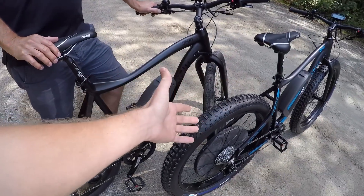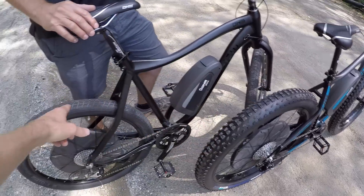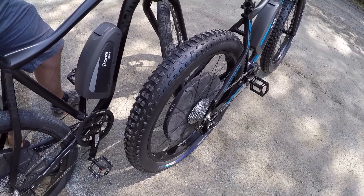That higher thread count allows you to run the fatter tire at much lower PSI without a blowout. You'd want lower pressure because this tire could be used on sand or snow, whereas the touring tire is less knobby and designed for hard-packed surfaces. The fat tire PSI rating can go all the way down to five PSI for maximum traction, and your contact patch would be enormous — plus extra cushioning.